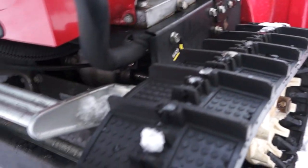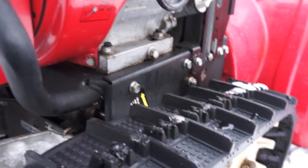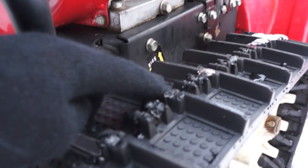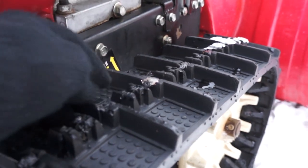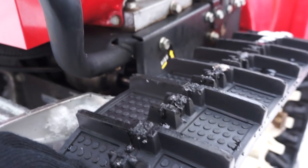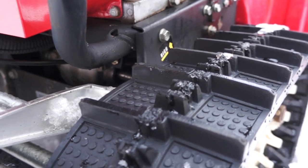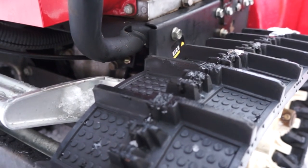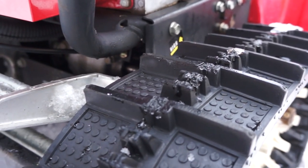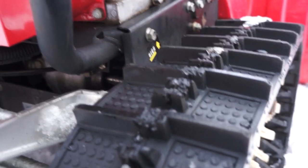Most of those wore out and fell off, and I took the rest of them off, but I did spot one here a while ago that was still on there. What I did was mount them right on the place where it comes together, where you get the most rubber to hook it into so it doesn't screw up the track. And they make studs now that you can screw in that are just like car tire studs, have a carbide insert on them, and you can screw those on. They have really wide screw threads, so they stay in there. And I may be doing that later.